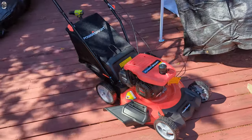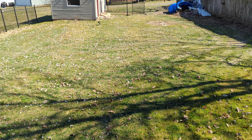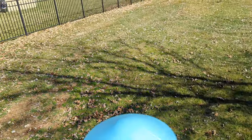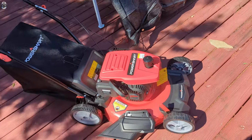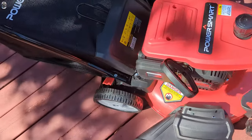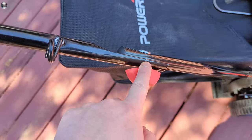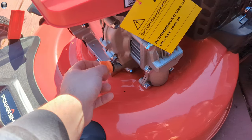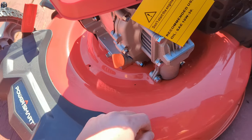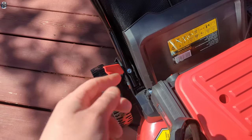Once the season comes and the grass grows, we'll be doing a second video to show this actually in action. We're still coming out of winter and the grass is still not green in some spots. I'm impressed by how easy they make everything. One bolt in here, one bolt in here, lift up the arm, tighten these in here. Put your oil right in here — do not overflow. It's better to pour a little, put the dipstick in, pull it back out, and check. You can also lift the cutting level with the lever on the front and the same for the back.